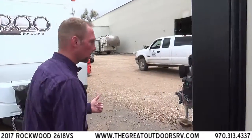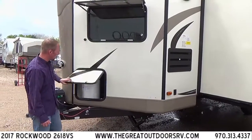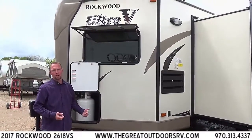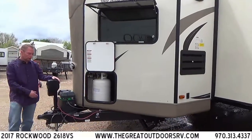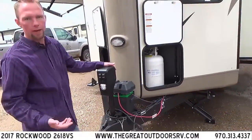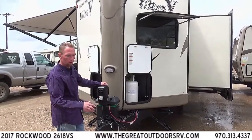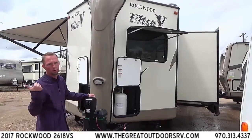Up at the front, you have two 30-pound propane tanks kept in a lockable, enclosed compartment so they're not exposed to the elements — no need for a propane tank cover. You also have the convenience of a battery disconnect in there, so at the end of a camping trip you can cut all interior power and not worry about a light draining your 12-volt system. We also bring it in with a power tongue jack with a built-in light, great since you're not always hooking up in daylight. It is a 2 and 5/16 ball, and I'd recommend an equalizer hitch — probably the mid-range E2 trunnion, which provides about 400 pounds of sway control and equalizes the weight off the hitch.